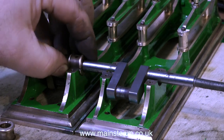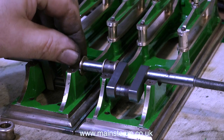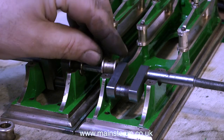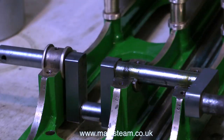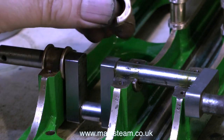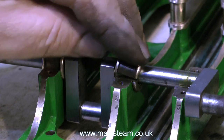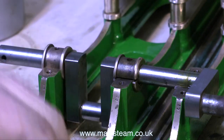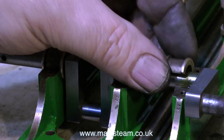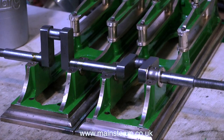So I swap them over and no, they don't really — they're better the first way around, which is the way they are numbered, so that will teach me to try and be clever. It's quite obvious that the man who originally built this engine really knew what he was doing. Even though I wiped the bearing shells with a cloth before assembling the crankshaft, I'm picking up some of this black stuff. The reason for this is because the shells were never a particularly tight fit on the crankshaft anyway — this will soon disappear when the engine runs. This semicircular mark on the main bearing has been caused by the crank web rubbing against the bearing when in operation, and it also confirms that the bearing shells are the correct way around.